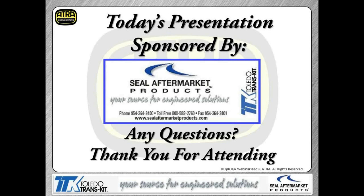Now, in the aftermarket, as far as remans, a lot of the reman facilities are using the 47RE plastic input shaft rings, much easier to work with. They go on there and they work very well. On the center sun gear shaft, they're using the AODE metal nickel plated rings from the output shaft of an AOD. They work very well here. These are the only two real locations that I feel that these rings should be addressed.